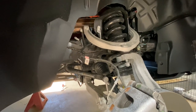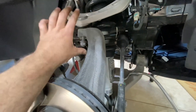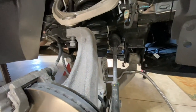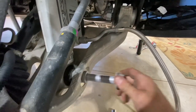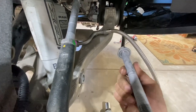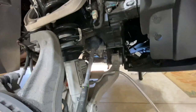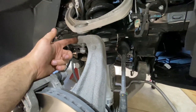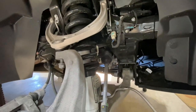All upper and lower control arm bolts are loose. I still haven't broken the ball joint free — I want to leave that together until the last possible second before swinging the arm up to get the strut out. We've now gotten to this massive lower shock bolt — 30 millimeter head — and the body of it is just gargantuan. We'll get that out on both sides, then tap the knuckle to break the upper ball joint loose from its tapered seat, swing the arm up out of the way, and hopefully get these struts out of here.